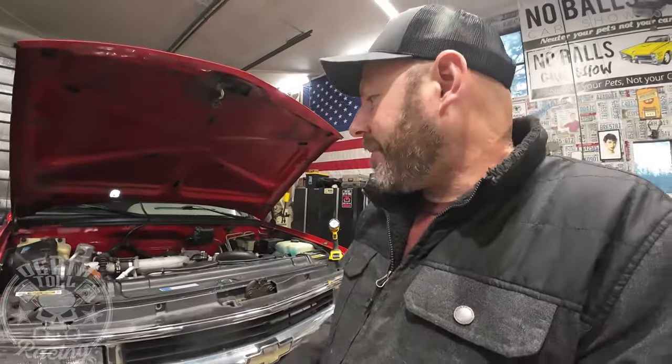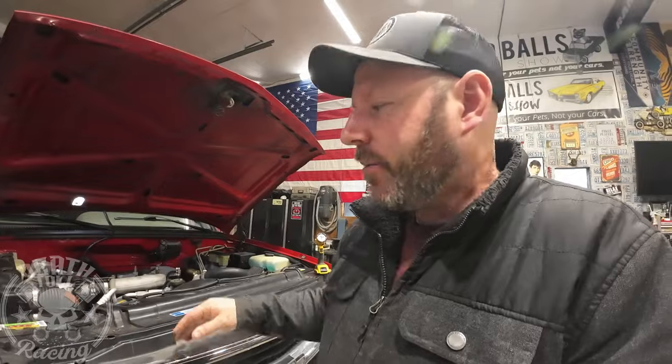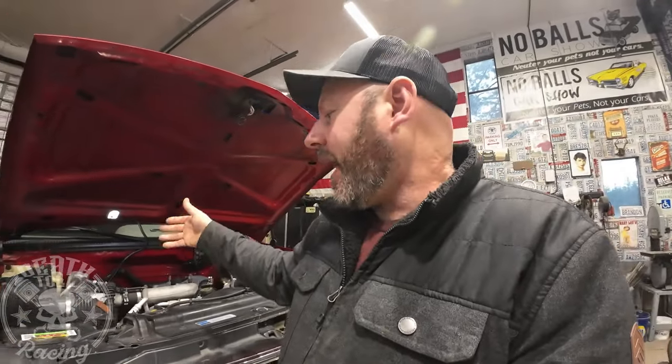Future projects coming up — the vacuum pumps are another one. That's usually just an annoyance because they go out and you have to change them, basically limping home because you don't have any boost since the wastegate's controlled by it. I've heard of them taking out the belt with them, which would be a side-of-the-road situation. So the manual wastegate thing is cool — it's much better, more reliable, and it allows you to get more boost and go along with that eTorque chip.